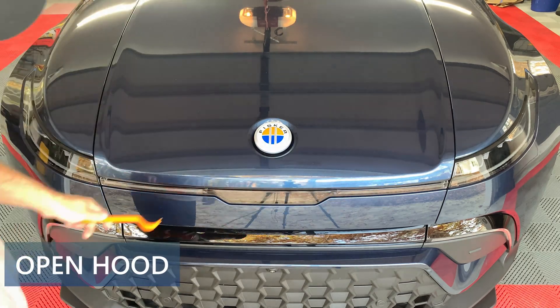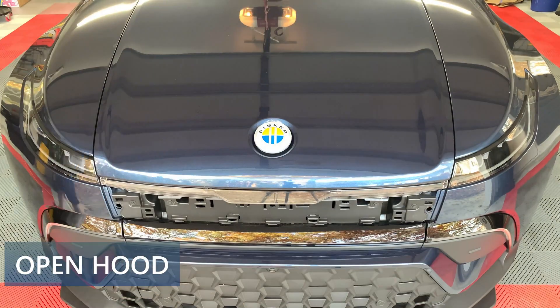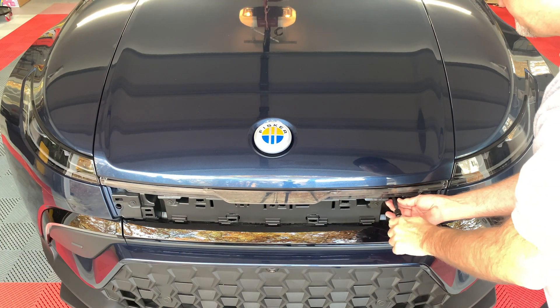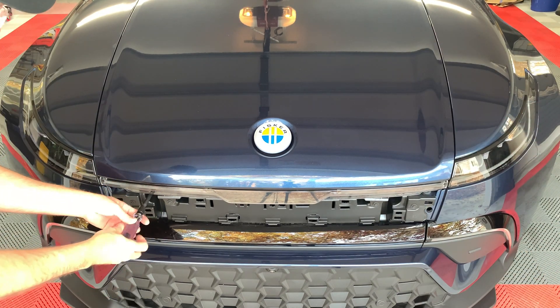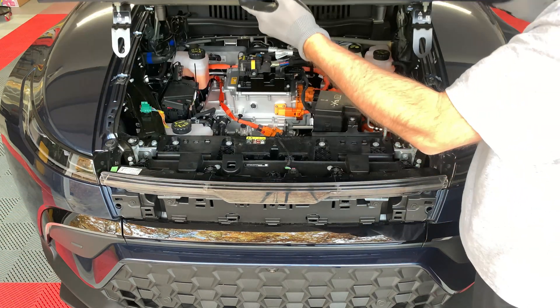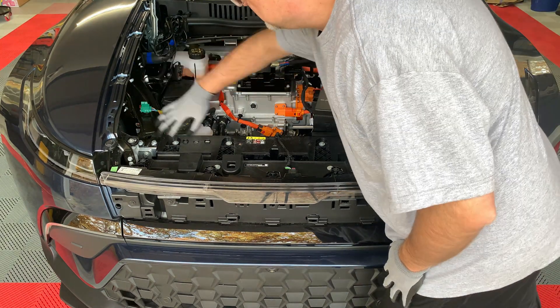See my detailed video on how to open the hood. Remove the service lid panel using the plastic pry bar. Then, using the 13-millimeter socket driver, remove the two bolts that are holding the hood in place and put these parts aside. Gently pull up the hood until the bracket snaps into place on the left side hinge. Now we're ready to start.